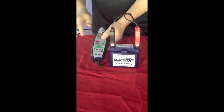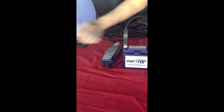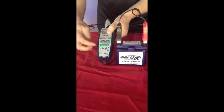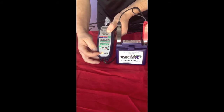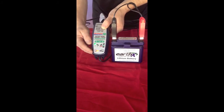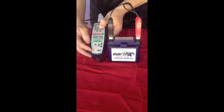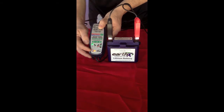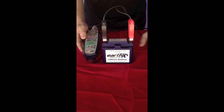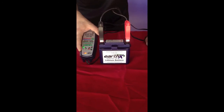The second step is to plug it into the wall. When you plug it in, you should see the green light come on, and then the save light. The save light indicates that this battery is in a low state of charge, and it's going to charge at a very slow rate to optimize the battery recharging. It will stay in this save mode for up to a couple of hours.